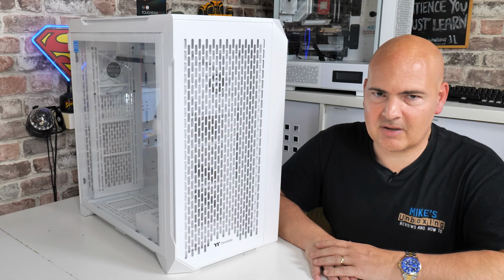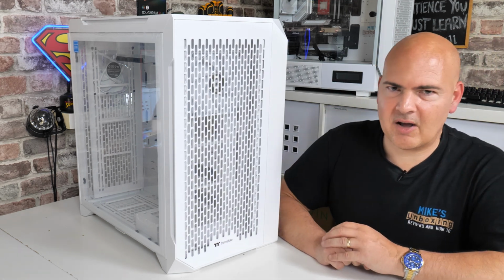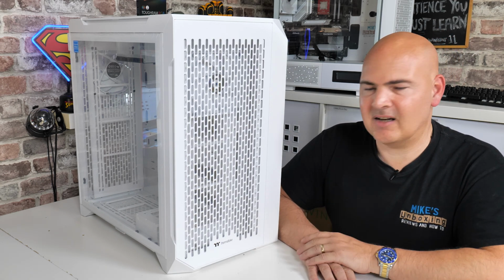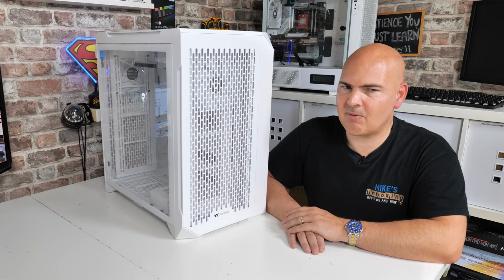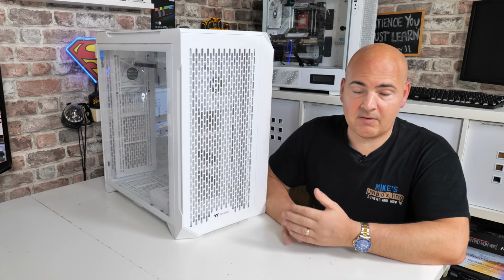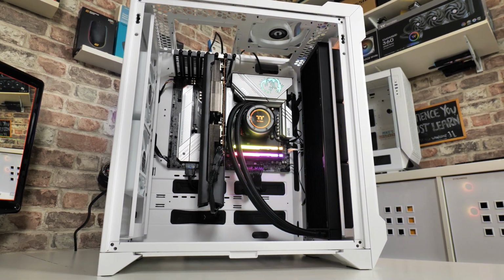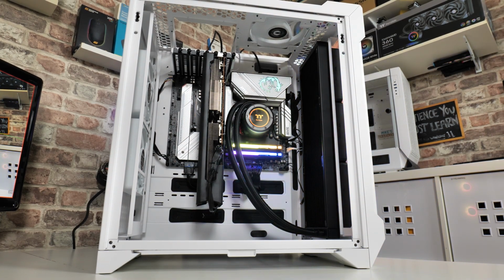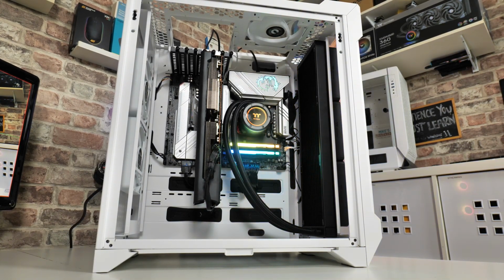So we're going to go through, like I said, take this thing apart, see what it's all about. After I've done all that, I'm going to be transferring the PC behind me, which you can see is currently off. I haven't got my screens on or anything, so this is actually ready and waiting. We're going to transfer all of my kit into this and do a build in one of these cases finally. Not actually done a build in a CTE case yet, so I'm kind of interested to see how it all goes, what you can do with the cable management, because obviously with the CTE technology and the fact that the motherboard is rotated 90 degrees, now, rather than having your I/O on the back of the PC, where it is traditionally, now it's going to be coming out of the top, although they've got some really clever and intelligent cable management situations going on up there, so it does look actually good and you've still got access to your ports, etc. So, with all that said, let's get on with it.